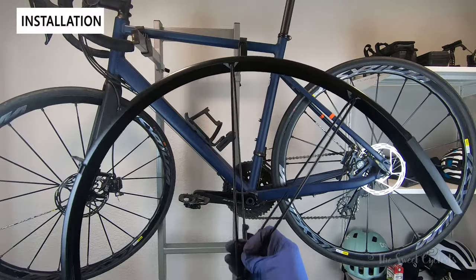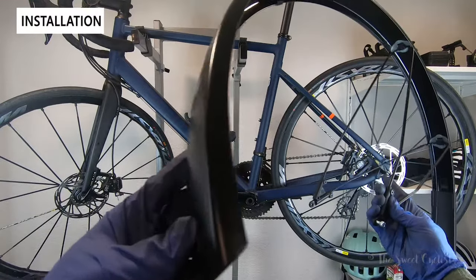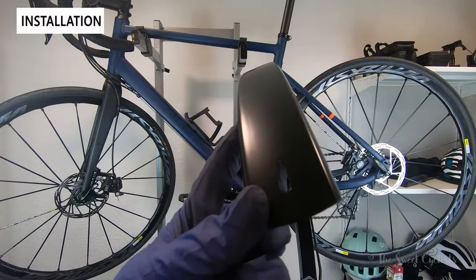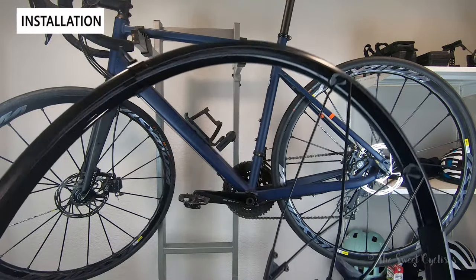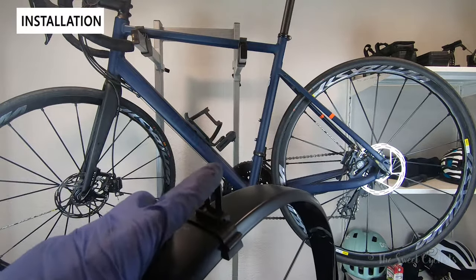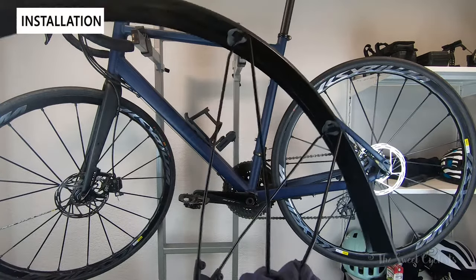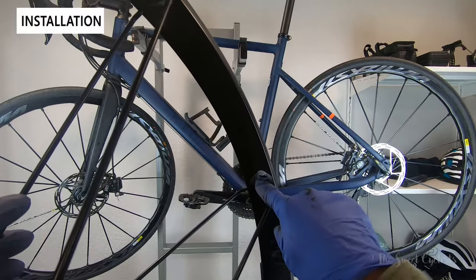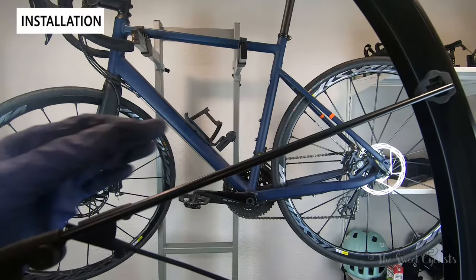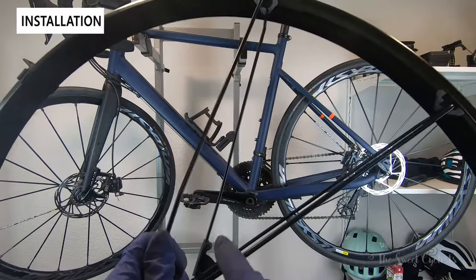Here is the larger rear fender — it's much bigger since it's for the rear wheel. It's one piece and doesn't have the cutout for the chainstay region, but it has a wider bolt area giving a bit more play. You have an attachment point to the frame at the top, and you align the struts and push them into the little tabs. For this bike the struts are actually too long, so they'll need to be cut down.